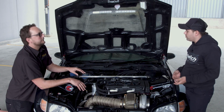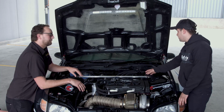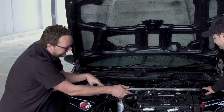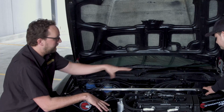When you buy these out of the box, they come 3.5 litre. By putting the extra spacer in there, it increases the actual volume of air to the intake manifold, and now it's 5.5 litre. Further down, it's got into the runners, you've got a bunch of injectors up the top. What sort of injectors are we using, or what's the fuel system up the front here?